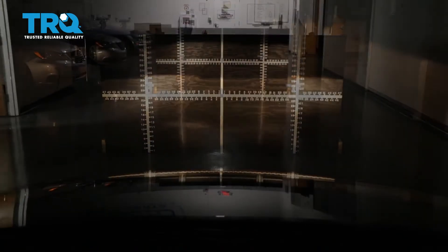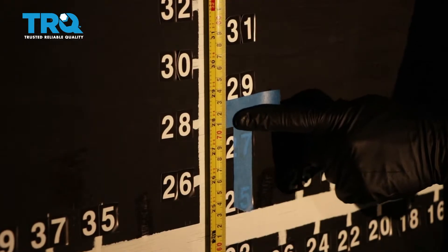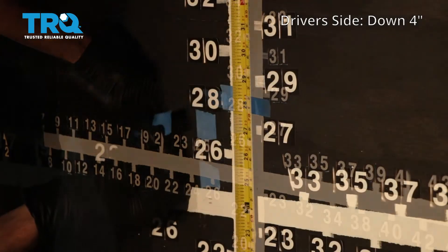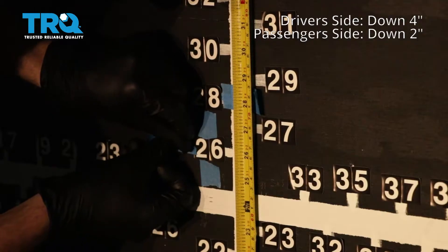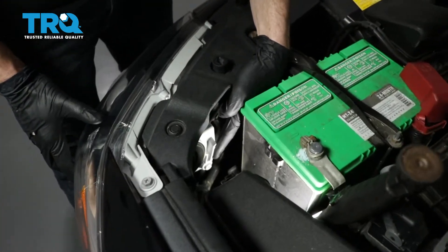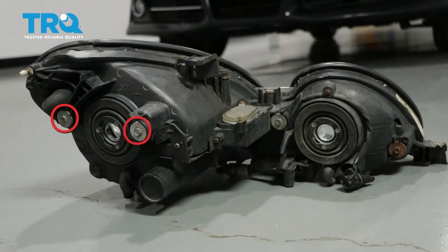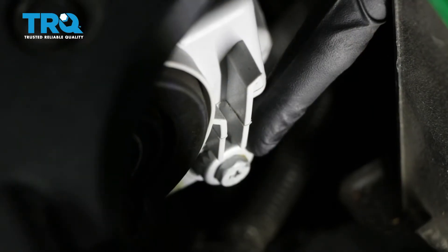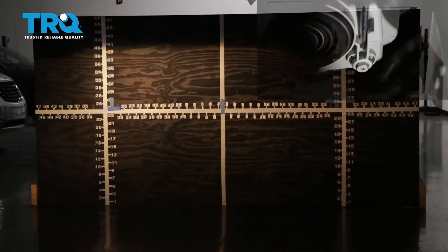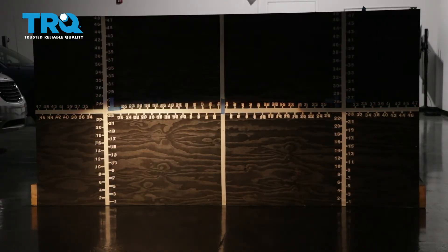Back the vehicle up straight back 25 feet from the wall. Now that we've moved 25 feet back, we start with our measurement — that's where the headlamp center is. On the driver's side, go down four inches. On the passenger side, go down two inches. To adjust the driver's side, cover your passenger side headlamp. On the backside of your headlamp assembly you'll see the adjustment. Some headlight assemblies have one, two, or even more adjusters, but you should have at least one. Turn the adjustment to the right to bring the beam up, and to the left to bring it down — this is the case on most vehicles. Lower the top part of the beam down to just below your line.